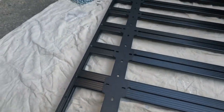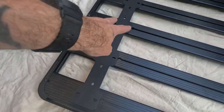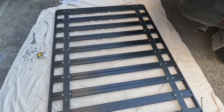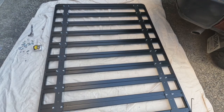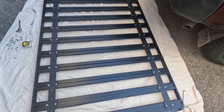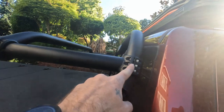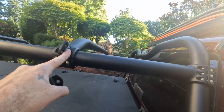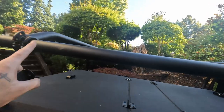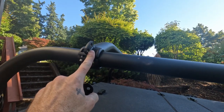Once the crossbars are laid out, start sliding the M8 bolts into the opening on your Front Runner tray and locking the crossbars into position. I laid the mounts in place, secured the ends tight enough to keep the bars from moving, and left the middle ones with bolts just threaded and ready. For my crossbars, I'm starting roughly about 15 inches from the front hoop, and from the center of that crossbar to the center of the back one is 48 inches.